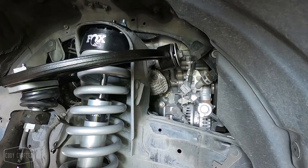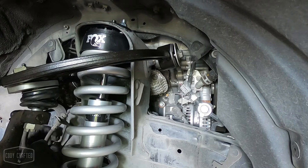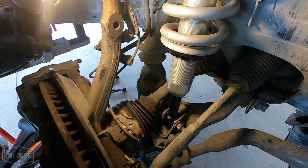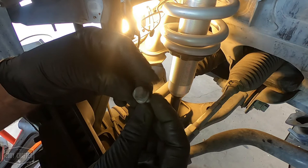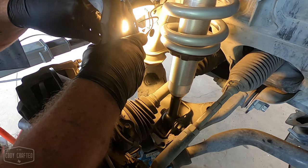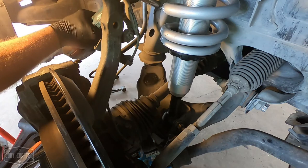All right, don't forget this little guy. Hold your ABS wire in place. We've got a 12 millimeter that holds this brake line on. Get it started back. 12 millimeter head, it's an M8 bolt. There we go. Old school drop light works great. All right, so this ABS wire clip, lay back, and retainer bolt. And there's two 12 millimeter head M8s. This one is the shorter of the two. It goes in the knuckle, upright. And a little snuggy snug. Good and tight.